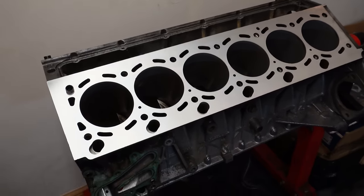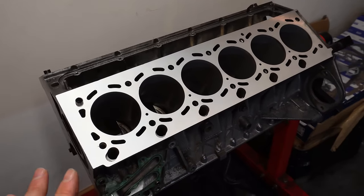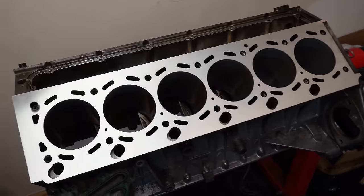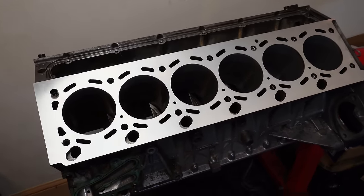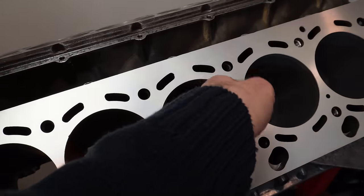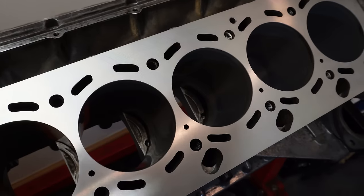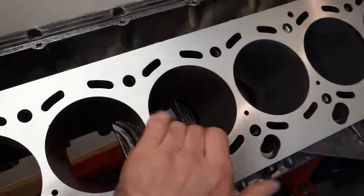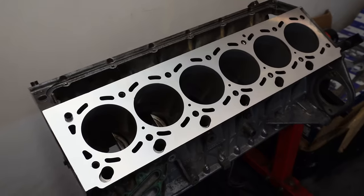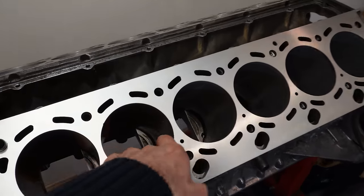I thought I might mention as well that some guys on the Porsche forums especially, I've seen one or two guys, they've essentially just slapped in new piston rings and they haven't had any real issues. So I'm not going to say that you can't really do this wrong. You can absolutely do this wrong, but it just goes to show that even with Alusil, it's a very hard, somewhat forgiving surface. Obviously, if you ran a stone into one of these, or if you scraped them in some ways, you're going to be in real trouble. But essentially, even if you just popped in new piston rings, and they're the correct size, chances are you might see an ever so slightly increased amount of smoke or oil consumption, but you're not going to do damage to the engine. Essentially, these are very hard wearing walls.